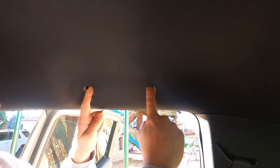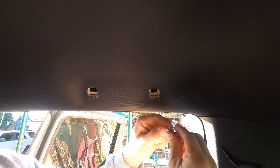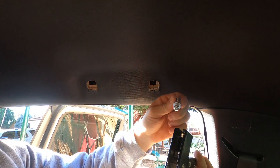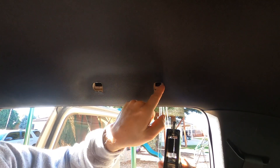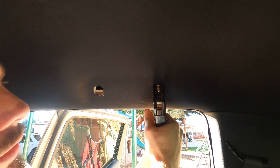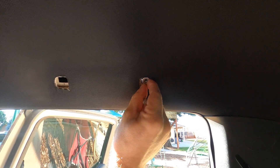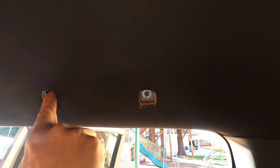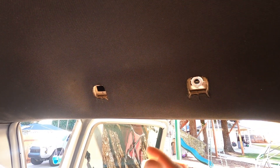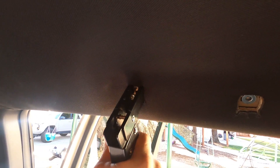Now that both have been removed, we're going to seat the jack nuts with the smaller included bolt. Screw it into the jack nut, then take the tool and slip it right in the top. You're going to want to put the jack nut directly in the center and squeeze. After that it's seated, unscrew the bolt. The jack nut should be centered right in the hole. We'll go over to the other one, threading it into the insert, seating it on the tool right in the center, and squeeze.